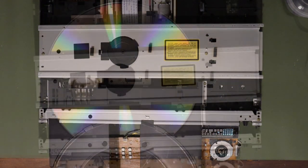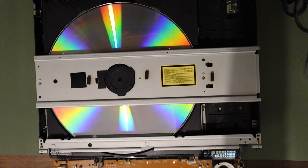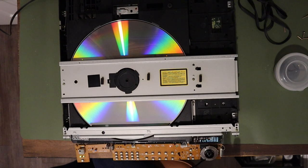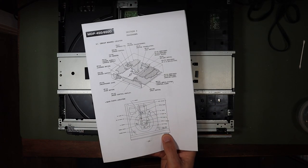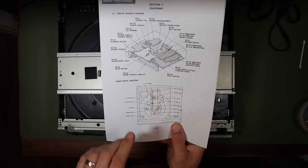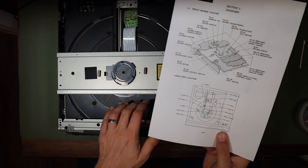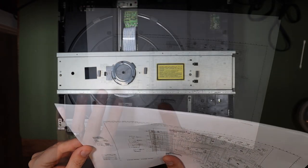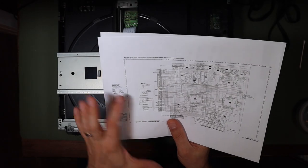I decided it was worth trying a disc. Nothing at all on the display, but it says 'closed' — so irrespective of what position it's in, it seems to think the tray is closed. Although it's closed, it doesn't seem to know it is — I think that's my next mission. Since the display board didn't know whether the tray was open or not, I decided to investigate the open and close switches. There is a tray open-close switch situated here, and that switch signal also goes to the 707 board. This signal needs to be good at both points for the microprocessor to know about it.